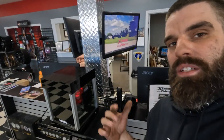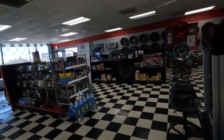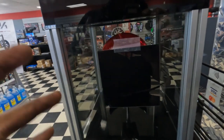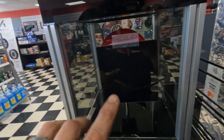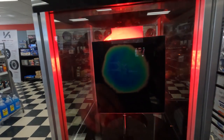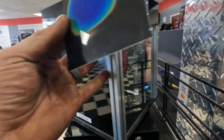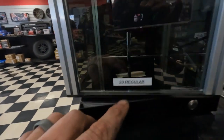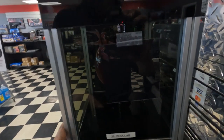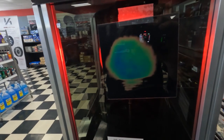Alright, so I'm up front now after getting the work done on the Jeep. What I'm going to show you is basically what I'm talking about — ceramic film and the difference between that and just a dyed film. What I have here is basically a liquid crystal film, and what this does is it shows heat. I'm going to turn this on. As you can tell, this is just glass — watch how quickly this heats up. You see the light on behind it and boom, there's your heat. So basically it's showing you how quickly that heat changes. So now I'm going to cool this back off. This is your 20% regular film — just basically a dyed film, no heat rejection really — and you'll see it'll heat up nearly as fast as the other window does.